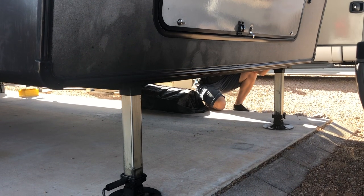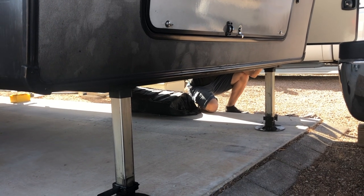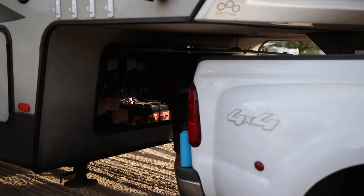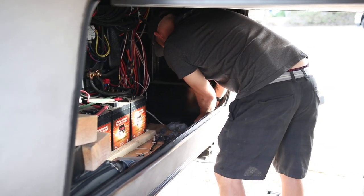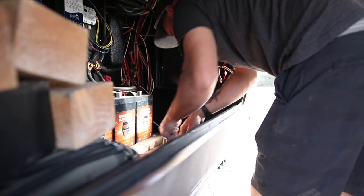Today's disruption: we tried to take our chappy over to an RV park to set it up and level it, and one of our front jacks bound up and locked. It only raised the rig about two inches and would not go any further. I tried to adjust it manually using a wrench, as per the owner's manual, but had no luck. When we hitched it back up to the truck and lifted the weight off the front jacks, the driver's side front jack actually slipped a couple of inches under the weight of the coach. Obviously that's extremely dangerous.